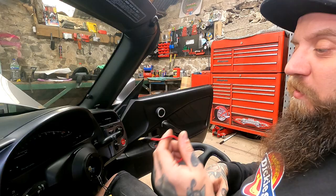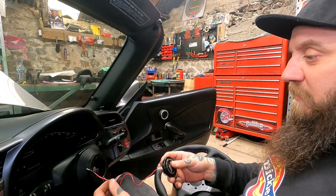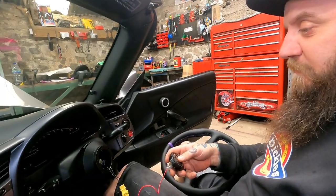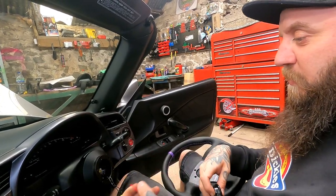Yes. Get the battery back on, because nothing can happen now, obviously, because there's no airbag in. And then we'll just maybe touch that onto there and press the button, see if the horn goes off. If it does, then it works. And then we'll turn that over to there. If it doesn't work, see what happens with that, and then touch it on somewhere and beep, beep.